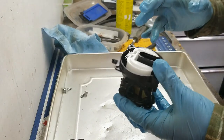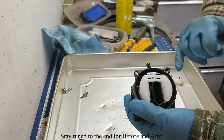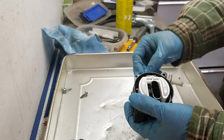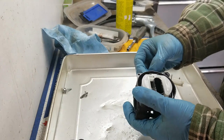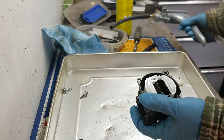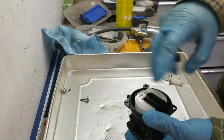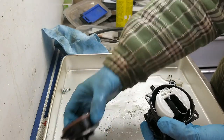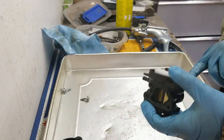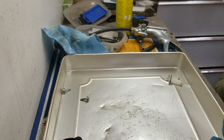All right, guys, so there's a lot of construction going on in my neighborhood. I'm gonna have to cut this video fairly short here now. The next thing I'm going to do, I'll just talk you through. I'm going to put my pressurization tool here, my Mighty Vac, hook that up, and make sure that the needle and seat is good. If it is good, I'm just gonna spray this all out real quick with some carb spray, blow it with some air, put it all back together. I'll get it back on the machine and then I'll show you whether or not this fix worked.